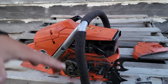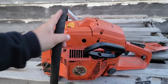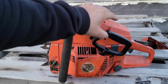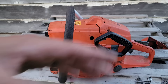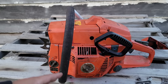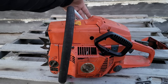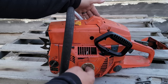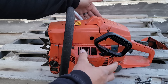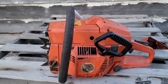Other than that, friends — timing. I wanted to show you guys all the things going wrong with this saw. I did order a new coil, a proper coil from Wolf Creek — it'll be here any day. Thank you, Ryan. The coil is for a 272; I put it in and the saw ran perfect till I put it in the wood. Now, if you want to advance your timing and you're curious how far you're going, I'll put the timing wheel on this side of the saw and rig up a pointer off the flywheel, mount it to one of the starter dogs, cross it over — and then when you turn the flywheel you can actually measure in degrees how many degrees you're advancing your timing. This one's about six degrees right now.